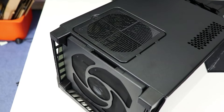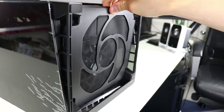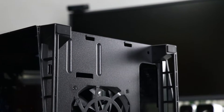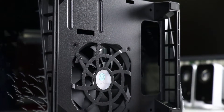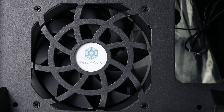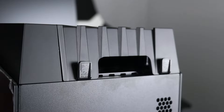Moving on to an actual fan-mountable intake, the base has a filter held in place with a perimeter of clips. Removing it reveals pressed steel sections forming the raised platforms for the power supply unit, and below there's a 120mm fan position currently occupied by a basic 3-pin 1200RPM fan. All the feet have rubber pads, and to the right there is something surprisingly useful — a cutout serving as a graphics card installation aid, 45mm wide and 130mm long, allowing just over a 2-slot fairly wide card to fit through.